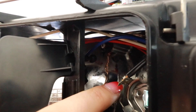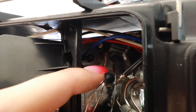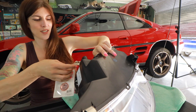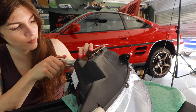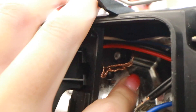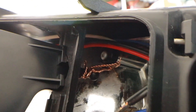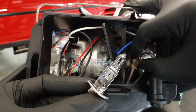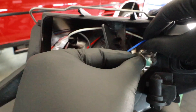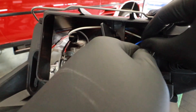There we go — a nice tight braid. Now I just need to join it up against that little knob. The second one I did, the nice straight one, I think that's even better. If I push on it — yeah, there's no play in that chrome bucket. I just bought some brand new OEM Sylvania halogen bulbs because I'm going to have off-road rally pod lighting on the front of the car, and these are not projector headlights, so I'm just going to keep the halogen bulb in there — what it's designed for. I won't be able to light them up until I get those pigtails, but at least I can get the headlights on the car.